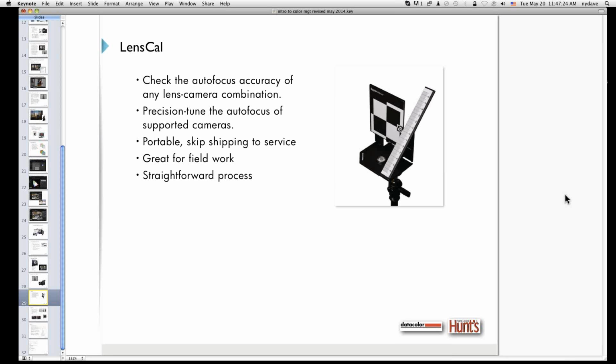You bought XYZ monitor in June and you went back and bought the exact same model the following February. It's no guarantee that they're going to be absolutely positively identical devices. That's one of the reasons SpyderTune is in the Spyder Elite software, is that there are some little changes that happen. Sometimes the monitors age a little bit. Sometimes one monitor has an sRGB color space, the other monitor has an Adobe 98 color space. There's a dozen different ways at least that they could be different.